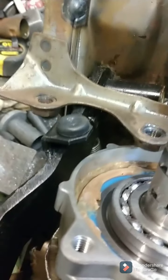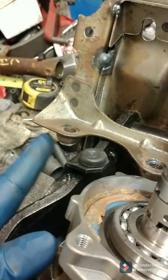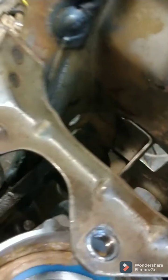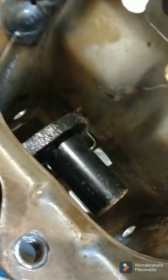And you see how this, I'm way away. I can go even further. But you see, even what I was thinking, this tab right here, to grind it off and flip it over and put it on here. And I'll use the brake switch where the clutch switch was. That's all. Now this is higher because that bracket, I'm touching it instead of getting in between. It doesn't fit in between. And I don't think you'd want it that far away. But ultimately, if I can cheat this like that, I gather it's about 3/4 of an inch.